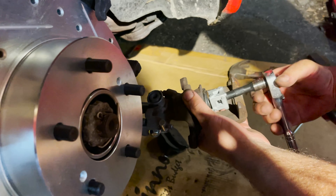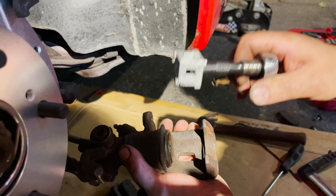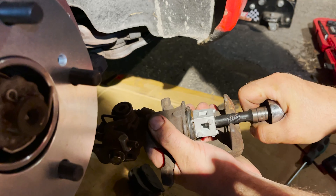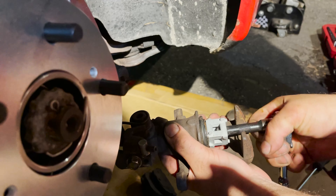For the rear, when compressing the rear brake caliper piston you're going to need a special tool - I'll link it in the description. It's a little different than most cars, similar to what Ford uses. You need this tool or else you won't be able to get the calipers or pads far enough apart to get onto the rotor.